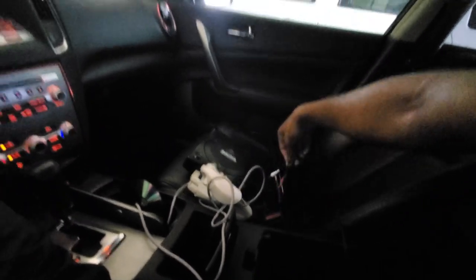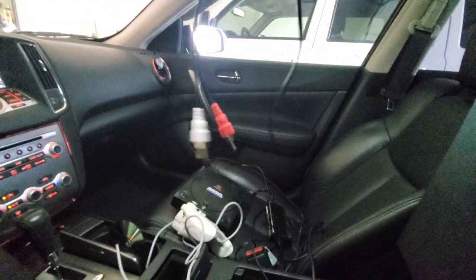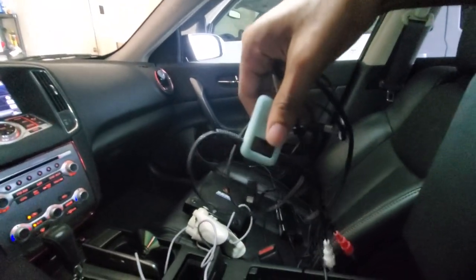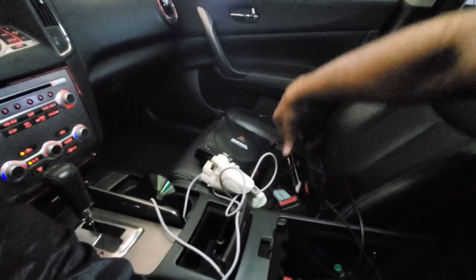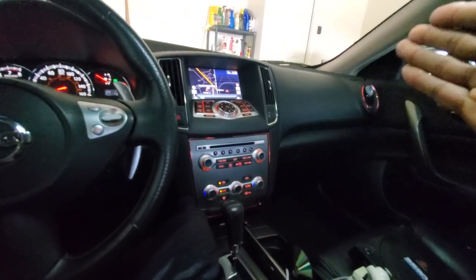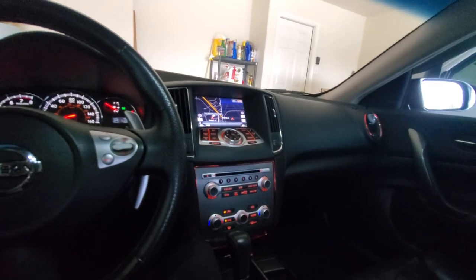You don't have an aux port without the tech package. You have to go to Walmart, Best Buy, Radio Shack, wherever — maybe the dollar store, maybe even the gas station. Get you some composite audio cables — the white and red cable. On the other end there's going to be an aux cable, 3.5 millimeter. You're going to plug this right into your phone or your MP3 player, plug these white and red composite cables right down here, and it's going to work just like that. You can play music from whatever, it's going to be louder, and you can still mess with the settings on the head unit and the MP3 player.